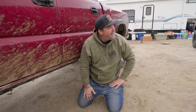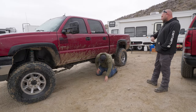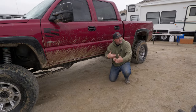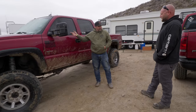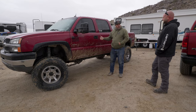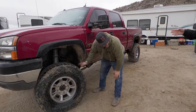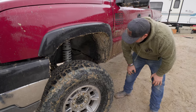I kissed a rock a few days ago — kind of turtled on it — and it skipped right off the skid plate and didn't even touch the T-case. One thing we want to work on is a bolt-in skid plate for the cross member to protect it. Doing the 273 swap, you still have push-button four-wheel drive with all the shift motors hooked up, no check engine lights, fixed yokes front and rear — 1410 at the T-case and 1350 at the axle.